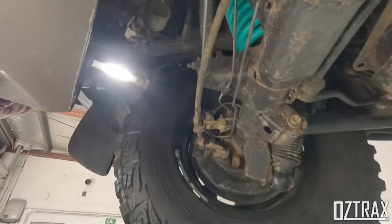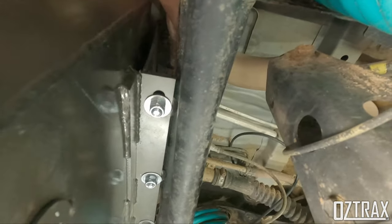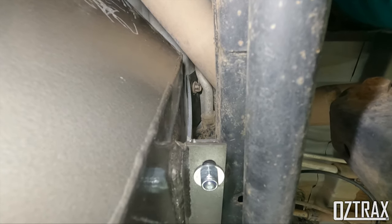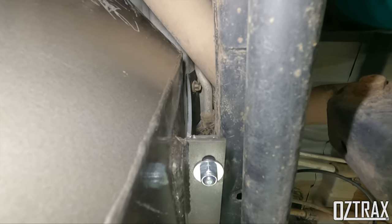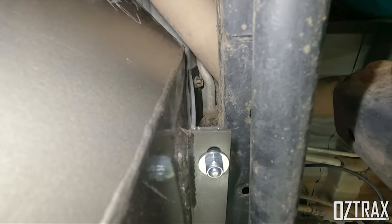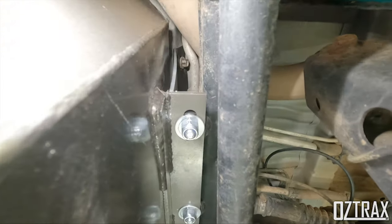And then in the back here, you've got the bracket with the nuts and bolts on that one. And then up above that, which I can't show you, I don't have a torch on, here we go. And then you've got the brackets up there. It has the retaining bolts around, a pain in the ass spot, so just got to put one more bolt back on, I think, for the aircon bracket. That's pretty much it. So it's in. You've got to make sure you put your rubber insulators between these brackets here and the chassis, to allow for flex. We had to muck around with the exhaust because it was touching up here, so we have clearance now. It's not much, but it's clearance. And yeah, we're just going to put the tow bar on and we'll be done.